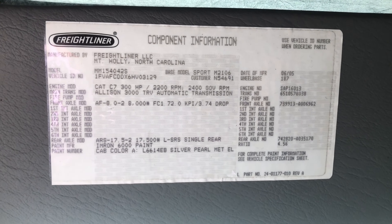Lower horsepower than the MBE 900, but what I like about this motor is you can see your alternator and AC compressor right on top — easy access, easy changeability. On a black 2006 I had with the Caterpillar, I had a bad AC condenser that was really easy to replace: pulled off the grill, slid out the turbocharger intercooler, pulled the condenser right out, popped it back in — a real fast process. Unfortunately on the MBE 900, the AC is down between the rails and wheels, which is a lot harder to get to.